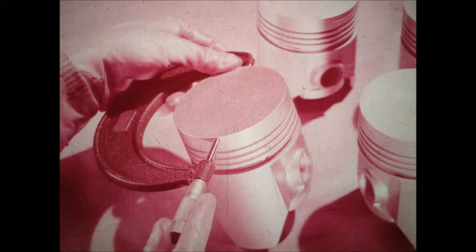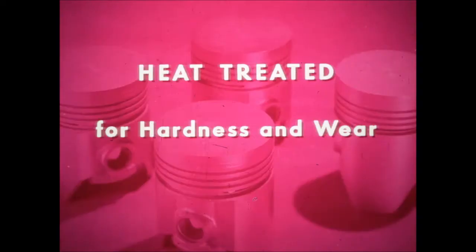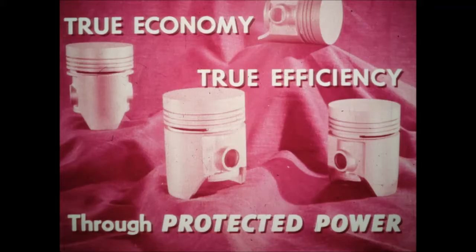They are made of a new, low-expansion aluminum alloy developed especially for this purpose. The pistons are heat-treated for hardness and wear, according to the most modern methods of manufacture. Then, skillfully tin-plated to prevent scuffing during break-in. This design results in true economy, true efficiency, through protected power.